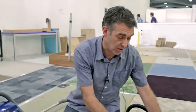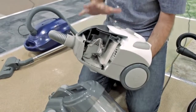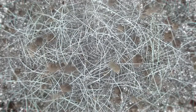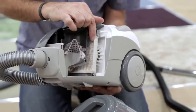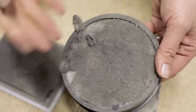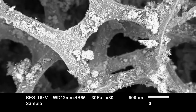Nowadays there are lots of machines that use cyclonic separation rather than bags. The trouble is a lot of these cyclonic machines aren't terribly efficient — a lot of the dust stays in the air. It goes through the cyclone, it isn't separated, and it goes through into the filter chamber. That's where the problem lies. The filter media is porous, like the fabric of the bag, and so the dust particles get clogged in the little pores and block it up, preventing the airflow from going through.